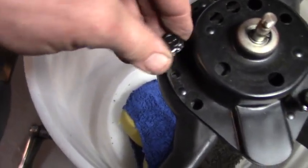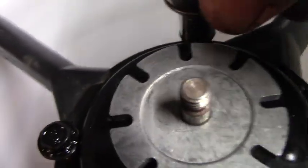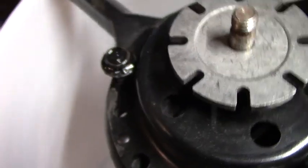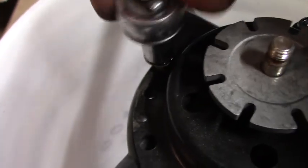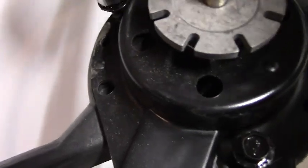So that would be right here. Always get your bolts started by hand before you go to the tool so that you're not chewing it up. Although I think on this one they probably chew up anyway. Tighten it down. And they don't have to be monkey tight because you're dealing with a plastic bracket. So just snug them down till it sits tight, till you've bottomed out the screw against the new fan. And it would be good.